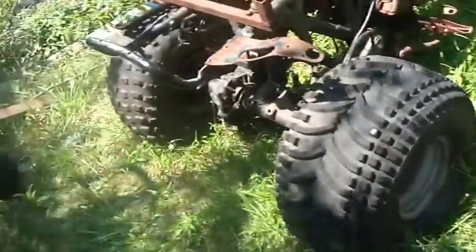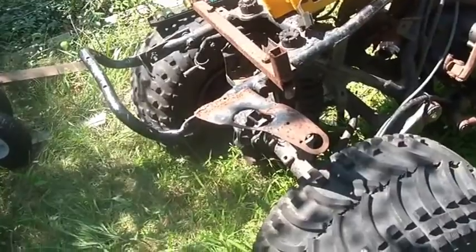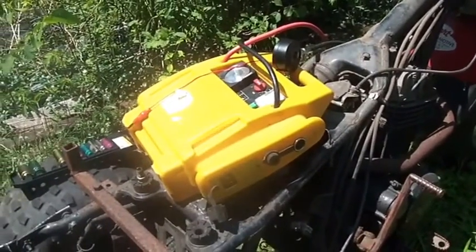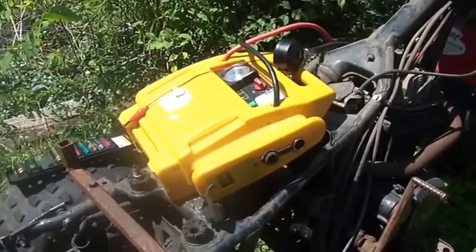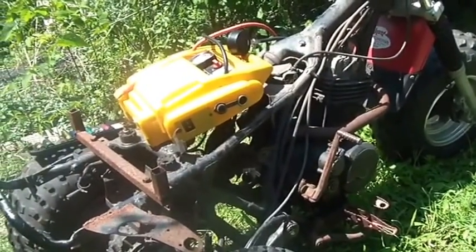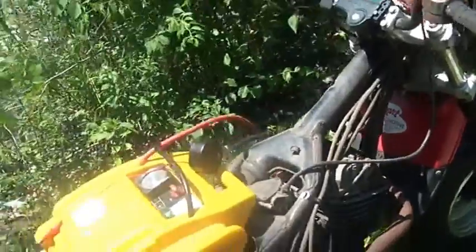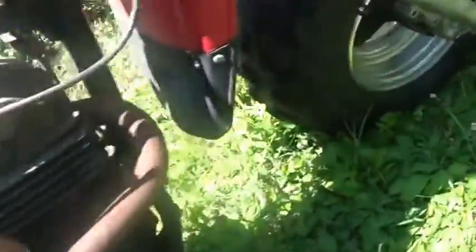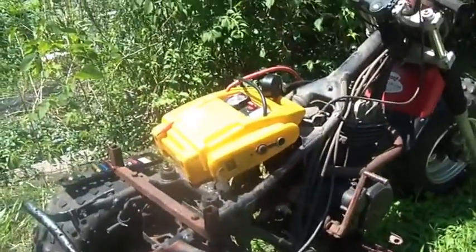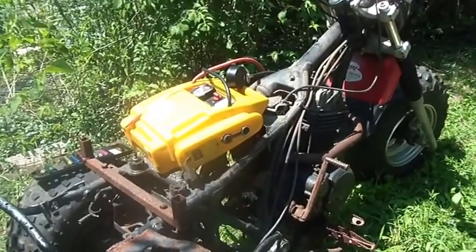The back tires will be good for the wheels. The gas tank — with a good cleaning and patching it could be sealed and used, but I probably won't do that. You can pick up plastic gas tanks for these things for about $150, and that gets rid of most of your troubles. As I look at this thing, I'm thinking the compression is low unless I put oil in it, which means it's probably rings. I have another engine where the head is damaged — the engine runs but the front mount is broken off and there's damage to the head where the exhaust pipe goes in. So this could be a good donor bike for the head. The exhaust manifold looks good.